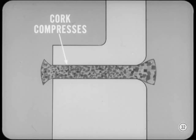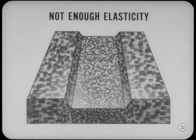And here's why. When you tighten a pan with a new cork gasket in it, the cork will be compressed as much as 50% of its original thickness. You may think that a used gasket still has a lot of compressibility, and maybe it does, but in spite of the remaining compressibility, there won't be enough elasticity to provide a good seal. And you can't be at all sure of getting the gasket back in the same exact position. So, invest in a new gasket.